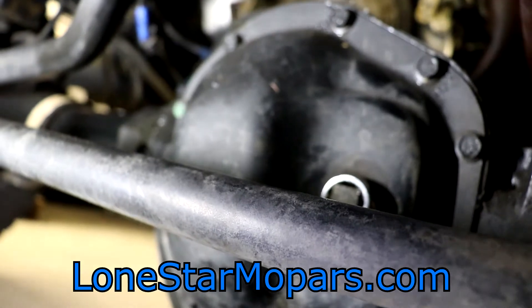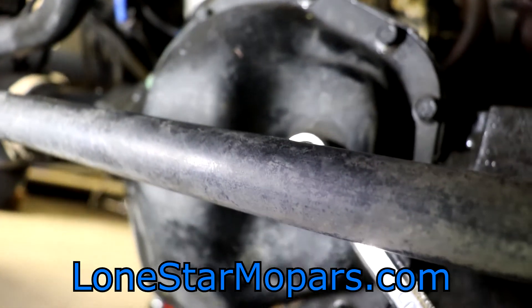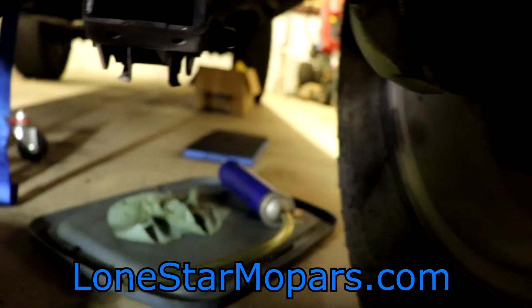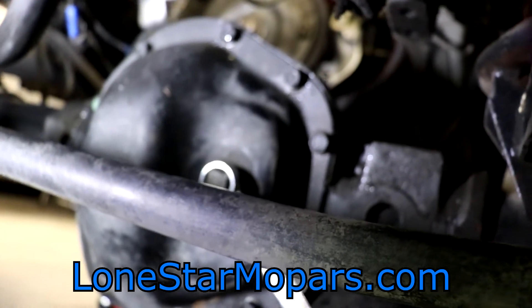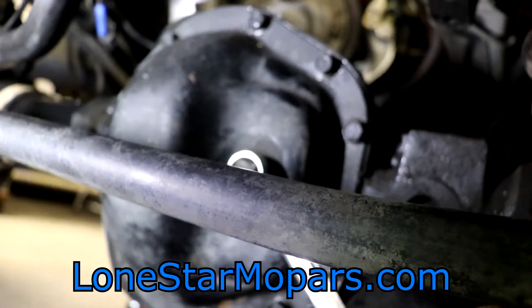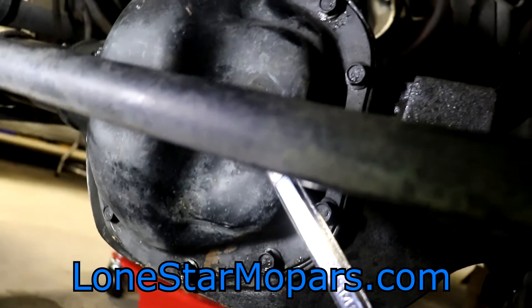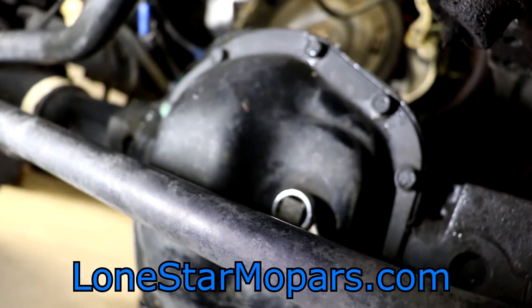Primarily, you have access to wipe the bottom — that's where all your shrapnel and metal would collect, obviously down towards the bottom. I think these are in fairly good shape, knock on wood, and I've wanted really badly to try using a pump like that to extract the gear oil. You could use a vacuum pump, which would probably be way better — currently I don't own one. Given the space constraints, if you're on your back on a creeper and you have to meander around over all of these suspension obstacles, it's possibly easier to just pull the diff cover and do it the old-fashioned way.